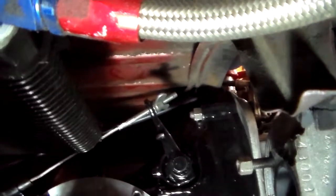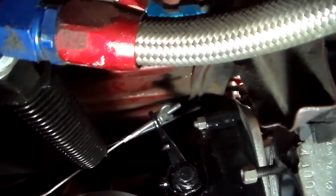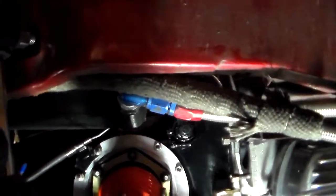And that's where it gets real tight, and it just doesn't feel like it can. And that's exactly what's going on. When it gets tight, and you get this spongy feeling, I don't know if you can see that, but that spongy feeling is the Bowden tube kind of flexing a little bit, moving the cable. So it just literally feels like you run out of adjustment, and then it's just solid. Like it's not actuating the diaphragm at all.